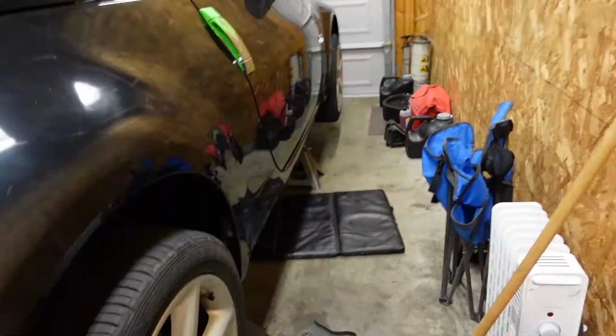First thing I did was just get the vehicle up on jack stands. The other thing about getting it on jack stands is it's important not to just do the front or the rear. I'd get it up on 4 jack stands because it is important to have the vehicle level when filling the transmission, because the way you know it's full is fluid starts coming out of the fill plug hole. And if it's leaning forward or backwards, the fill plug I think is kind of towards the rear. So if it's leaning backwards, you would think it's full before it is. And if the car is tilted forwards, you would overfill it. So yeah, it's just important to have it level. Just put it on 4 jack stands all on the same notch.